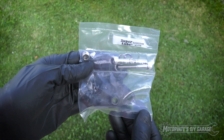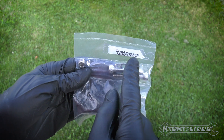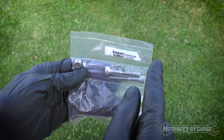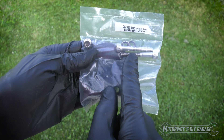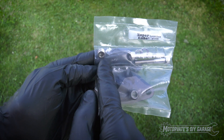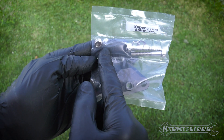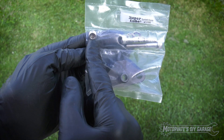Here's the package we got from CJ Motorsports. In the very top, we've got some nice synthetic grease which is for the O-rings — this prevents the O-ring from getting nicked and causing a fuel leak. Down below, we've got some nice stainless steel hardware as well as a 1/8th NPT plug, just in case you don't always want to run a pressure gauge because of the engine heat. I bought a $10 gauge — I wouldn't trust it under the hood for very long, so I may just use that plug.